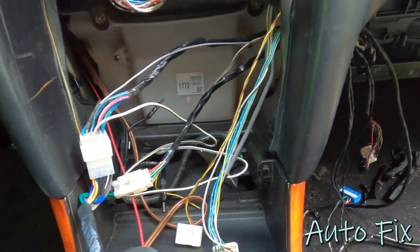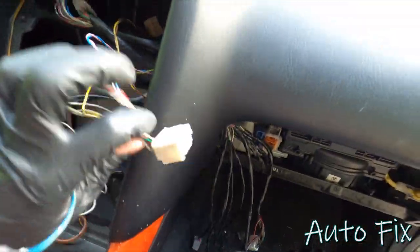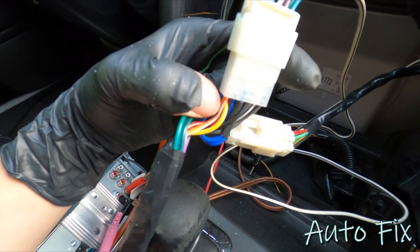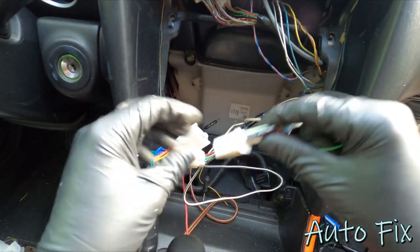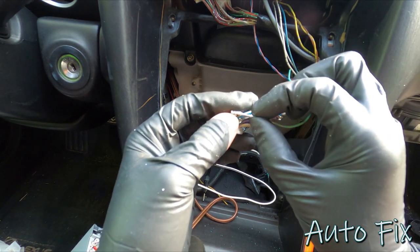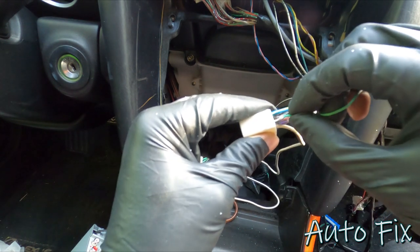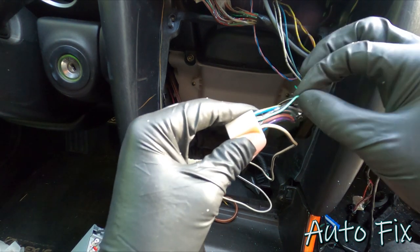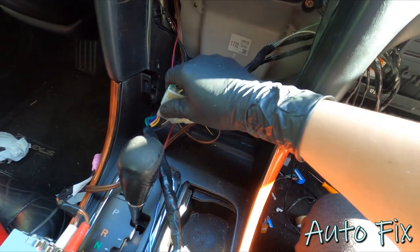I got the wire free - I'll admit I destroyed the connector, just cutting it for weight reduction. The wire needs to go into the orange wire's slot on the other connector. Disconnect your wiring harness before doing this to give it room. There are two little dimples on the bottom of the connector you want to line up with the indentation at the bottom, then just slide it in and it should click into place - and it's locked in.